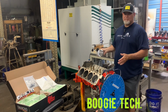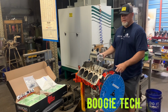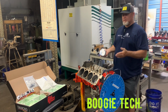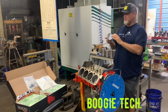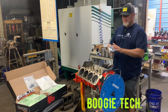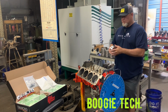So it takes me 3 to 4 hours to really check this, because each time I bolt this down and torque it a little bit, take that back off, inspect the clay, advance the cam or retard the cam like I was doing, just to double check that we can play with that cam and still not tag a piston. We make sure that the valve pocket here releases good where it stays away from the side of the valve. So it always works out really great.